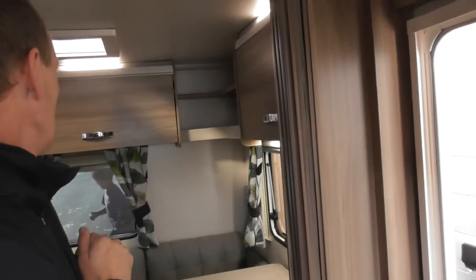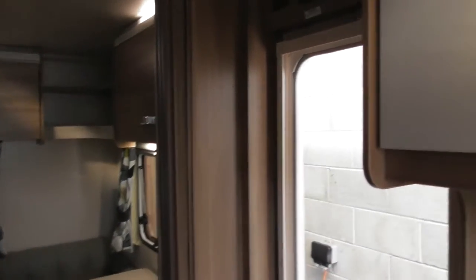If you had the heating on it, you'd be drawing the heat away from the boiler, so the temperature is not going to get up to heat on the tank straight away anyway, so it'll take a while to get up there. So what it will do, it'll shut the fan down. Once it gets up to the temperature on the water side, it will revert back to normal running, say hot, and then it will allow the fan to come on if it needs, if the temperature in the room's colder. Okay. So I'll just click it back to eco.